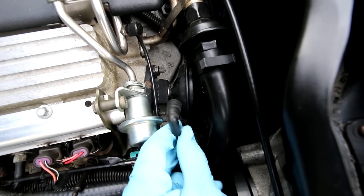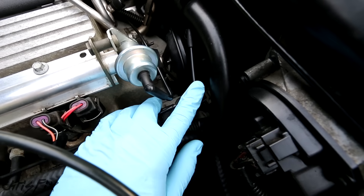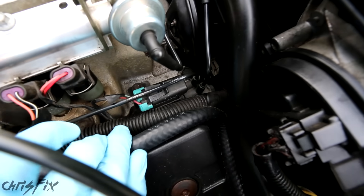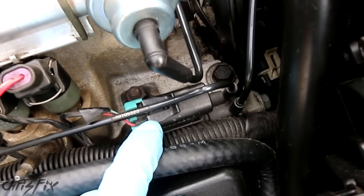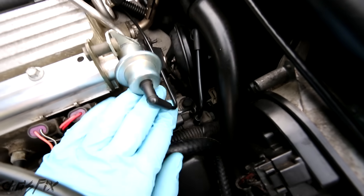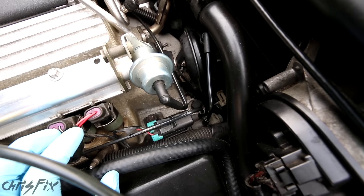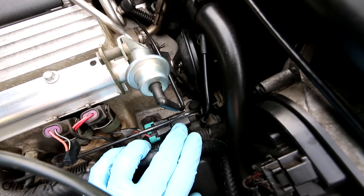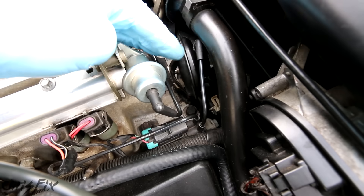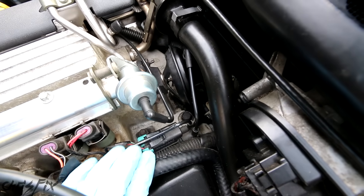The third part of the EGR are the actual vacuum hoses. There's a vacuum hose that runs to the EGR and then there's vacuum hoses that run to the EGR solenoid. The fourth and final part is an electronic valve that regulates the vacuum for the EGR. When the computer says it's okay, this allows engine vacuum — the vacuum pulls on the valve, the valve opens and allows exhaust gas in. When the computer says shut it off, this closes the vacuum and the EGR shuts off. Those are the four main parts that can go bad.